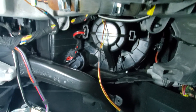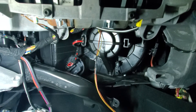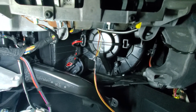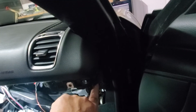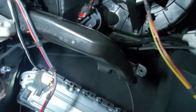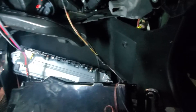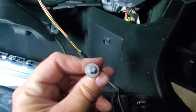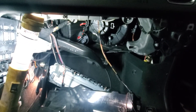As far as getting into the dash, I'm not making a full video on how to do that. Basically you have to pop the glove box out — there are a couple of clips that hold it in and about six screws up underneath. You also have to take a little side panel off next to your AC vent and remove this whole panel. You also have to take the airbag off the bottom, and you need a female Torx for that.